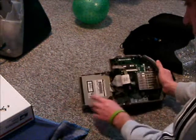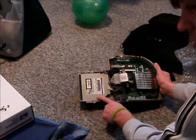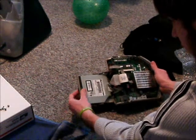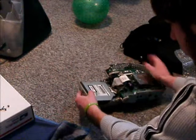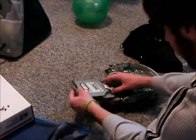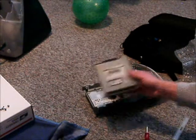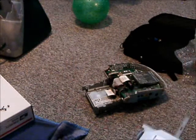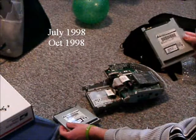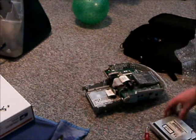Our problem is the CD-ROM drive, and I got a replacement — an original replacement. Hopefully it works, because this one just clicks at me when I try and do stuff. It's super simple to remove; it's simply held in place by a little spring, you push it back and it comes up and you unplug it. This one was manufactured July 1998 and the replacement drive was manufactured October 1998, so it's slightly newer.